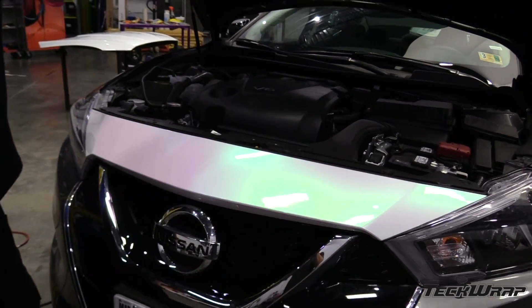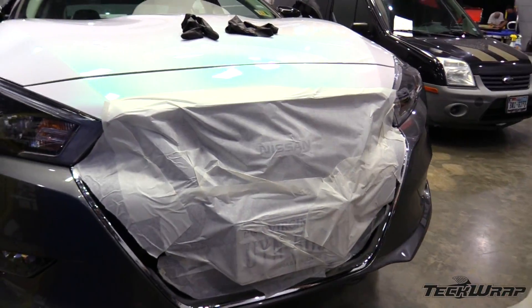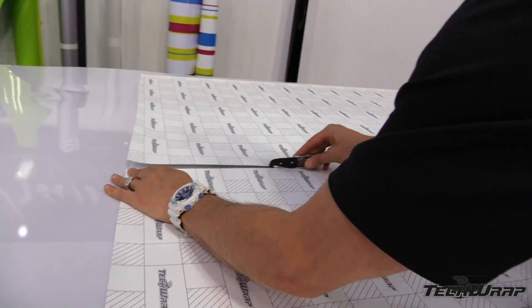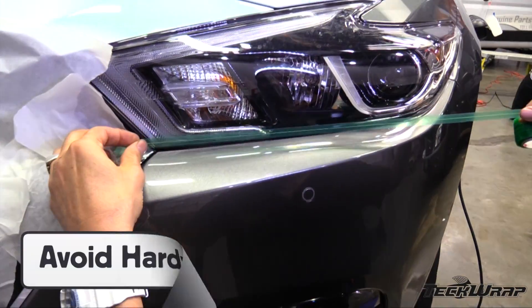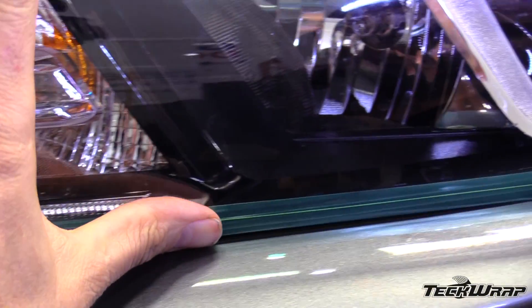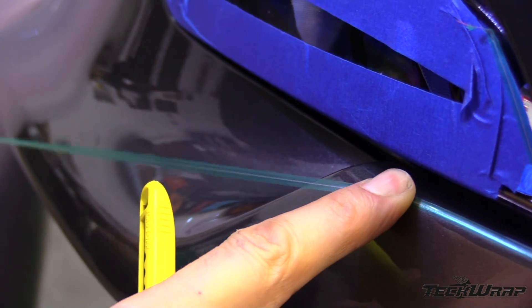For bumpers, use pre-mask on vents and open areas. Wheel well covers can safely and quickly keep dirt down. When sectioning up a bumper, in most cases the front and back bumper can be cut from one large panel off the roll. Cutting tape can be used to avoid removing hardware, including in the case of front lights, which are always tricky. Also, for hard areas, plan the cutting tape ahead of time to ensure the film isn't overstretched.